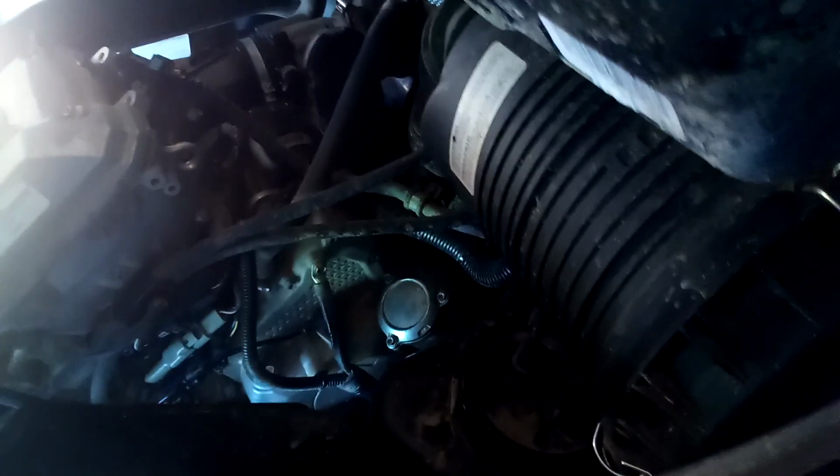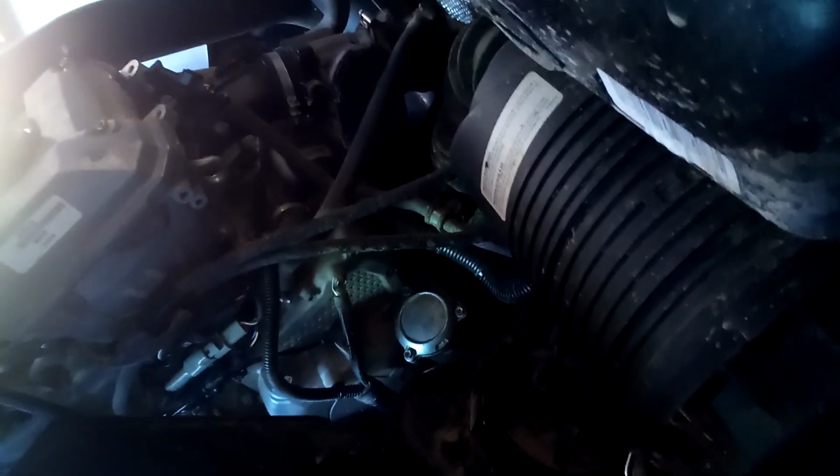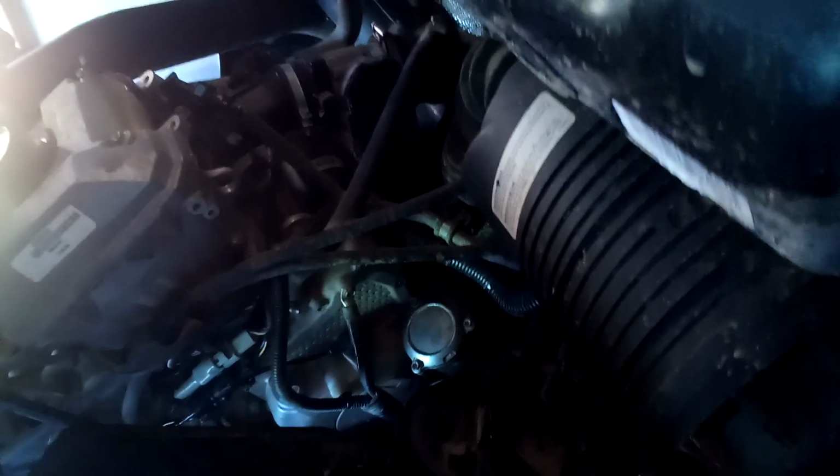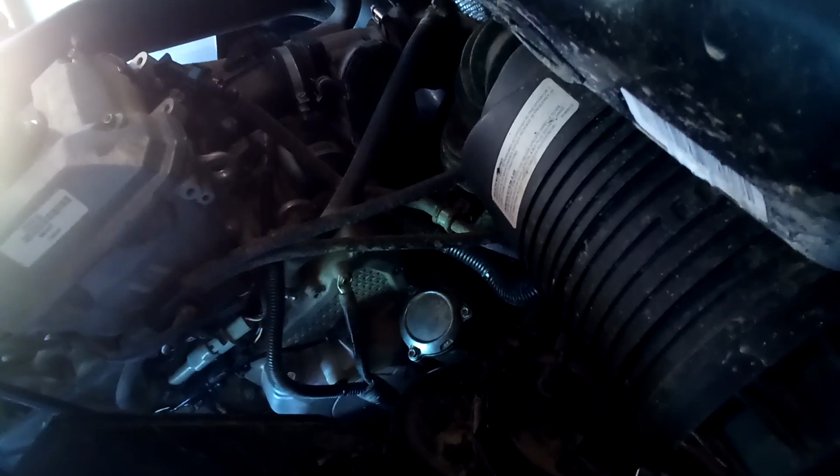The reason it was full, even though what was in the kit was less than what the specs sheet said, is because probably everything didn't drain out, and then I had the oil on this side of the oil pump where the filter is, but it was fine. It looked great. There were no shavings or anything on the drain plug.